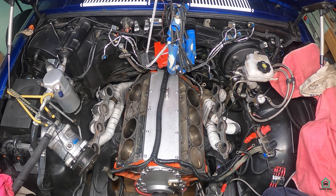Next to go in are the lifters — they go into the lifter tray, then head gaskets, and then the heads go on. Off-camera I also cleaned the bottom surface of the heads. They're aluminum so you've got to be careful. I also cleaned the surface of the valves and lapped the individual valves, and I replaced the springs, retainers, and seats. That's all been done ahead of time in preparation for putting them back in.